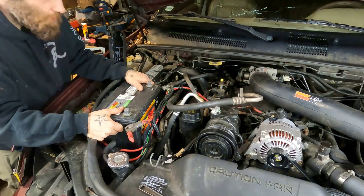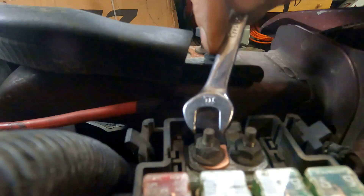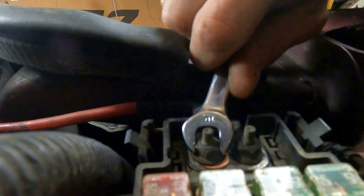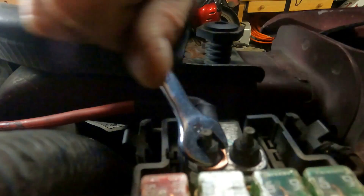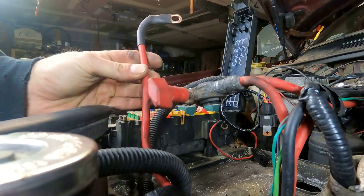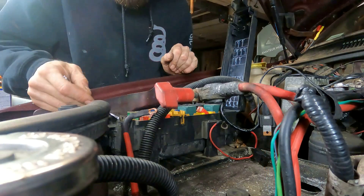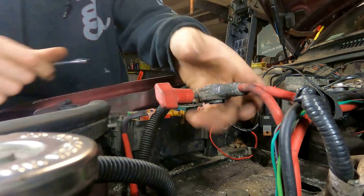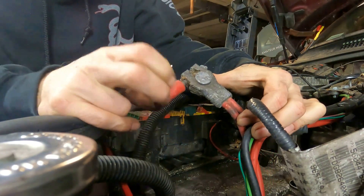Let's start by disconnecting the battery. We're actually going to replace the battery terminals as part of this — there's really no way to replace that supply line without cutting your battery terminal here on the WJ. You can pull the battery out to make things easier and to prevent accidentally arcing on it. I tightened the heck out of that — I didn't want any issues. There you go. So there's the repair that I made. Right here is where that fusible link would have been.